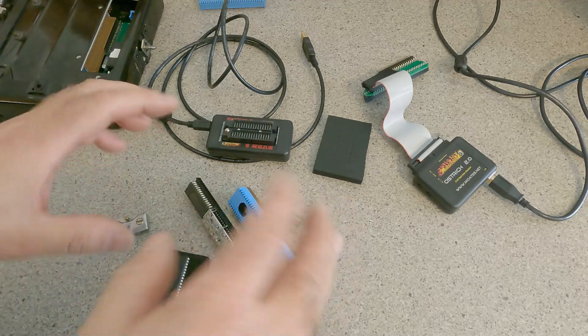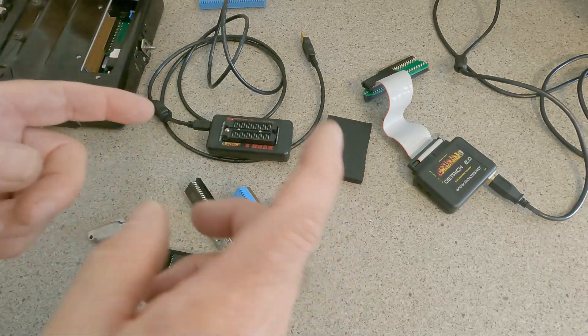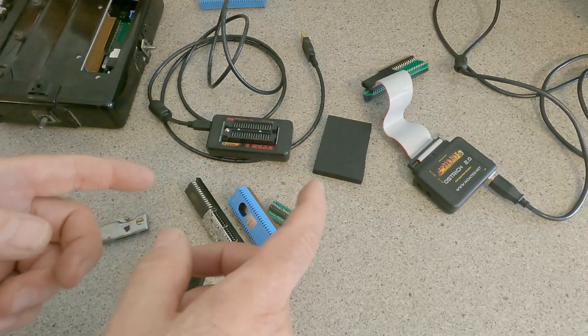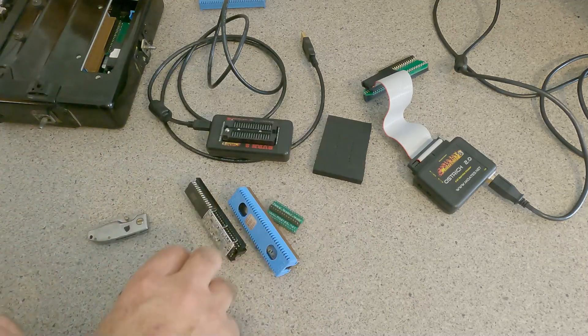As far as the GM stuff goes, I believe BoostedNW also has adapters for other makes and manufacturers for OBD1 — you have to check with him. Some of those you actually have to solder the adapter board in for the chip. If you get one of these modified memcals with the erasable chip in it, just be careful — check your knock counts. Make sure the knock counter module is correct.